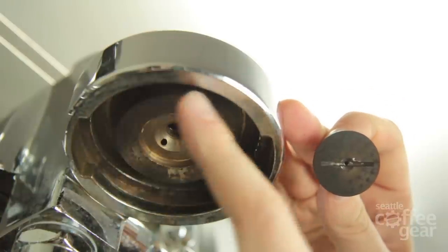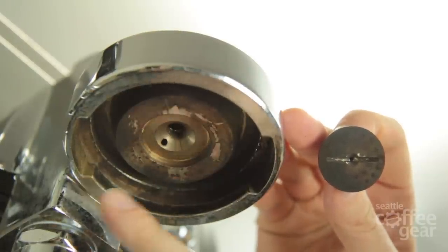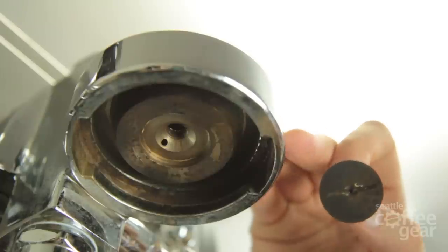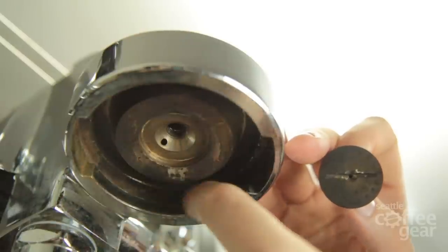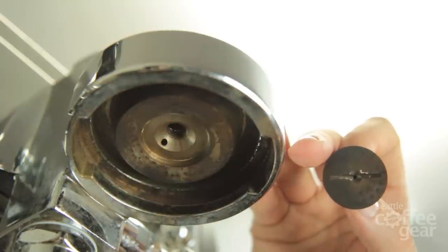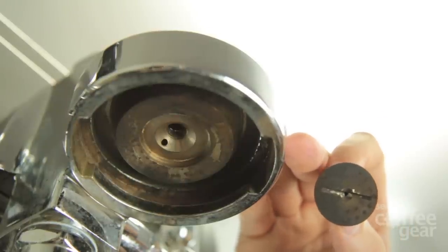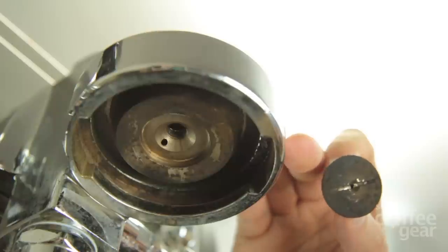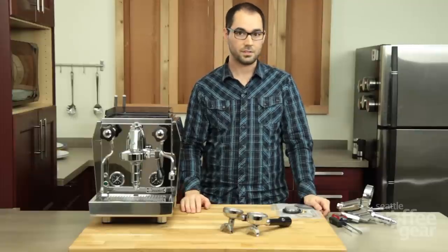While you're cleaning the brew head out — which you'll want to do thoroughly — soak your diffuser in Cafiza-based water or hot water and give it a good cleanup. You can also see all the coffee residue up inside the brew head cavity. Some customers have had success using an old toothbrush with hot water to get up there and remove as much as possible. Others use a small vacuum attachment for loose grounds. You'll want to get this as clean as possible, because it's going to affect the life of your new brew head gasket. Coffee grounds are very acidic, and if left in there, they'll slowly eat away at your new brew head gasket. Now that you have your gasket, shower screen, and diffuser removed, let's go through the installation process.